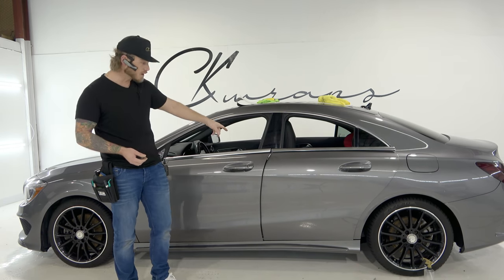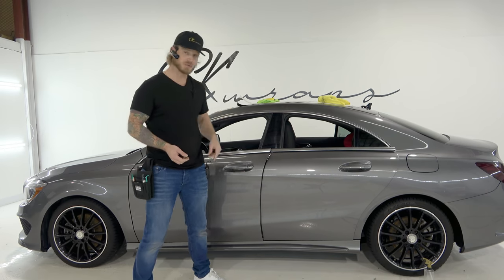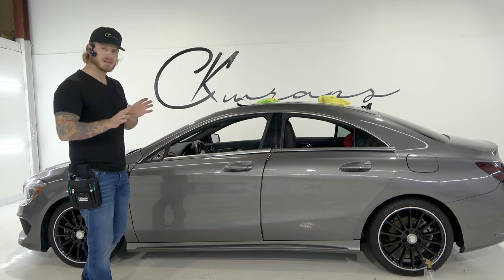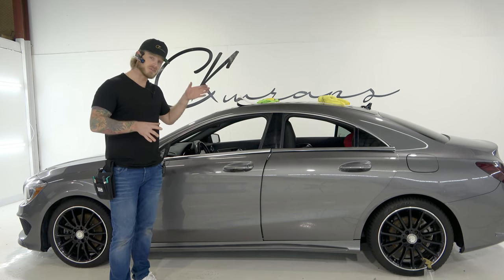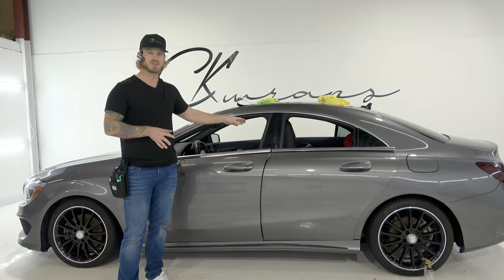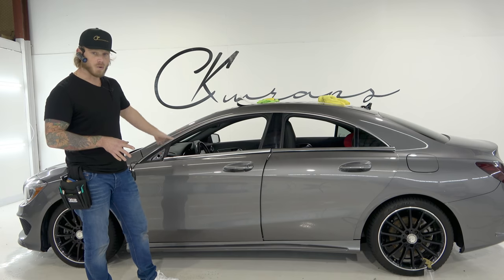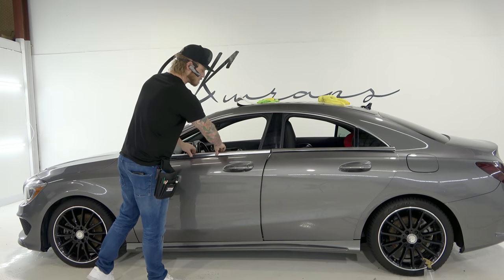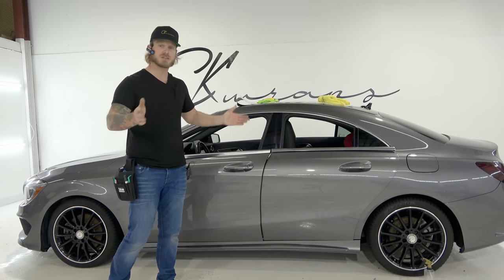In this video I'm going to show you a little trick on how to wrap these in one piece without having the vinyl fail on the ends, which is where most people run into a problem. Otherwise it's pretty straightforward — it's about being able to tuck. The difficulty of this job varies from vehicle to vehicle. For most Mercedes it's very common and pretty much the same. Anything within the past decade or so is about the same. Being able to remove the mirror and get these window trims up is important so you can wrap around and keep things as covered as possible.